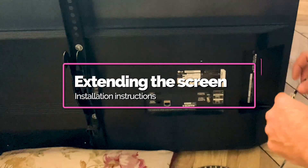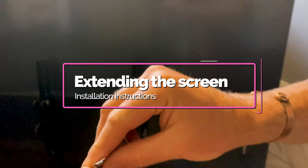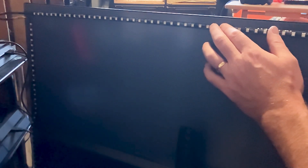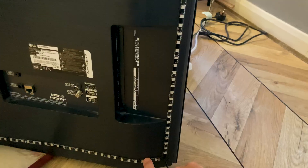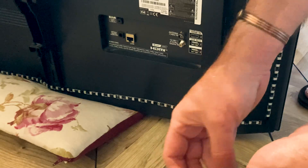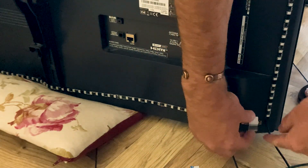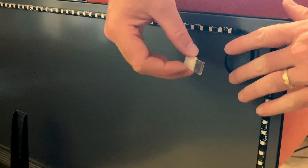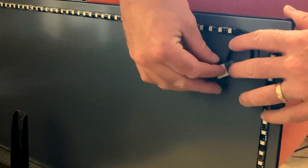The fitting to the TV is very simple and quick. Once you unpack the LED strips, they come with 3M tape — just peel part of the end back and start from where your HDMI ports are on the back of the TV. For mine it's the bottom right, so we go from bottom right to bottom left, then up to the top, across from left to right, and back down to where we started. You then take the 3M clips and attach them to each end of the LED cables and the loop cable that joins them up, to make sure everything is neat and nothing gets snagged when putting it back on the wall. Once done — only a few minutes — you're ready to test it.